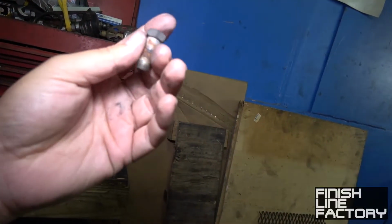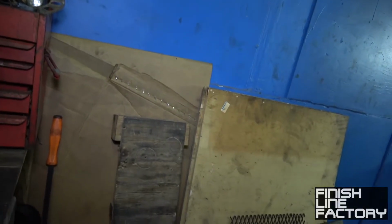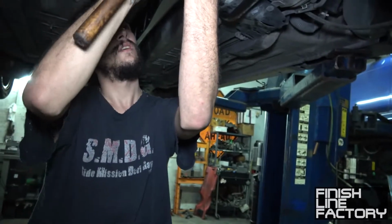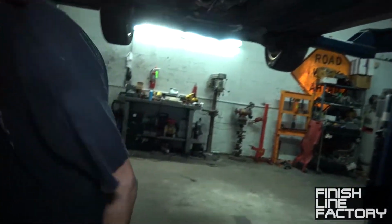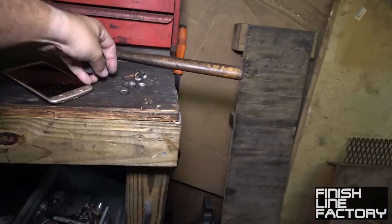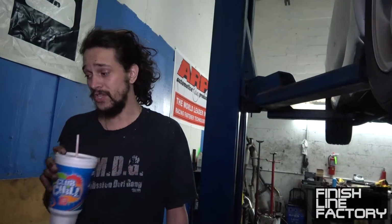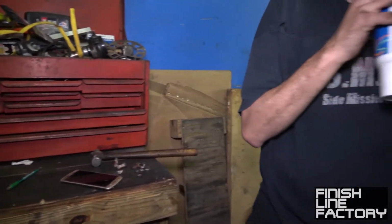The bolts have seen some use. You think I should run down to the store and get new bolts? Nope. Besides that, you don't want Home Depot in your car. Remember your KA with all those Home Depot valve cover bolts? Terrible. Well, these are just plain bolts, though. Yeah, but if you're trying to do it all new from scratch, 10.9 grade bolts, the zinc plated stuff. Get the good stuff, or just get all your bolts replated. No, I'd probably just get some brand new 10.9 grade stainless steel bolts or something.